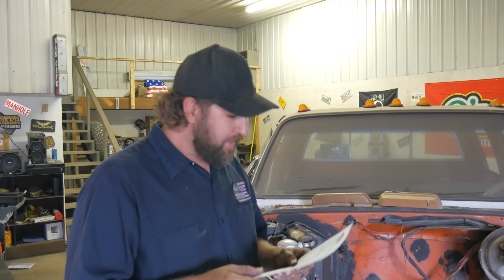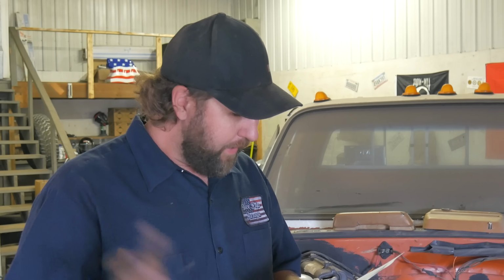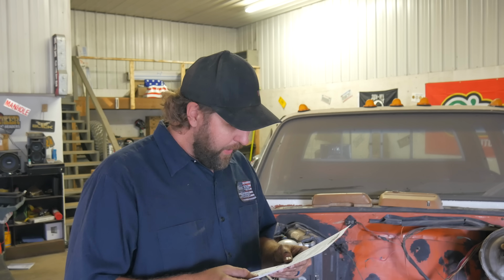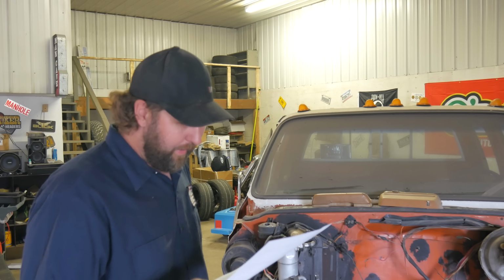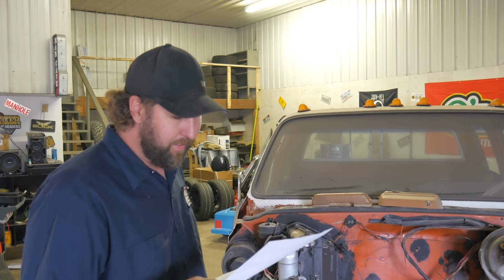Disconnect battery. Drain the radiator and remove it. Got that. Check. Evacuate the AC system. Nailed it. Remove the OEM condenser and dryer. Nailed it again. Remove the AC lines. I mean, I'm winning right now. Remove the compressor and bracket. Check. Evaporator blower assembly. I think that's this windmaker thing over here. Do need to remove that. OEM heater hoses, AC lines, and hard lines.